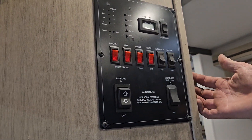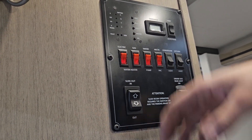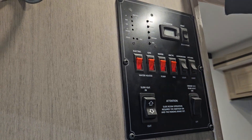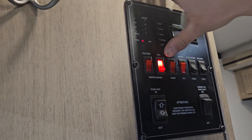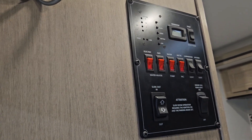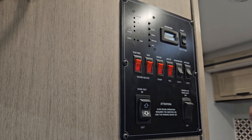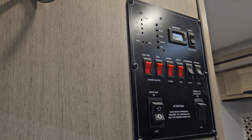You have a driver side light you can turn on. In the water heater section, you can fire your water heater on gas or electric. When firing it on gas, hit that button — the fault light is going to come on. The water heater will try to light itself three times; if on the third try it doesn't light, the fault light stays on. At that point turn it off, go hit that reset button on the outside, turn it back on, and it'll try to relight itself.